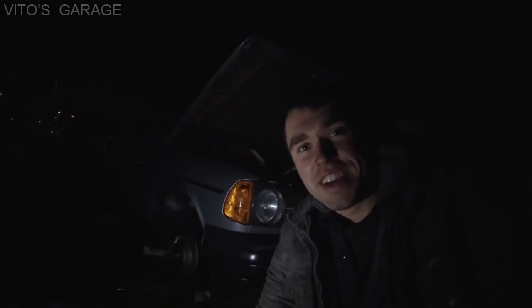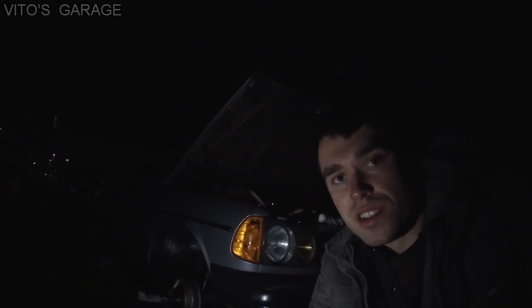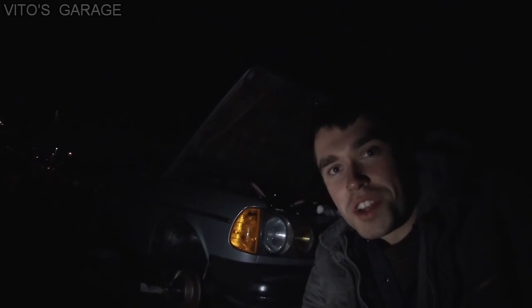Hey guys, welcome back to Vito's Garage. It's pretty late and dark, but I just want to shoot this video to show you something. I'm actually working on my turbo drain. I can't miss this because I have the turbo out and I'm doing a lot of other things to this engine. I saw the turbo drain and it looks like somebody's been working on it before, but it's still seeping just a little bit of oil. I need to take it out. The funny thing is I already replaced the oil pan gasket, cleaned the oil pan from the inside, and painted it — I really don't want to drop the oil pan again because I also replaced the oil and filter. So I'm going to show you what I did and how I actually took that turbo drain tube out of the oil pan without dropping it, so you can do it yourself too.